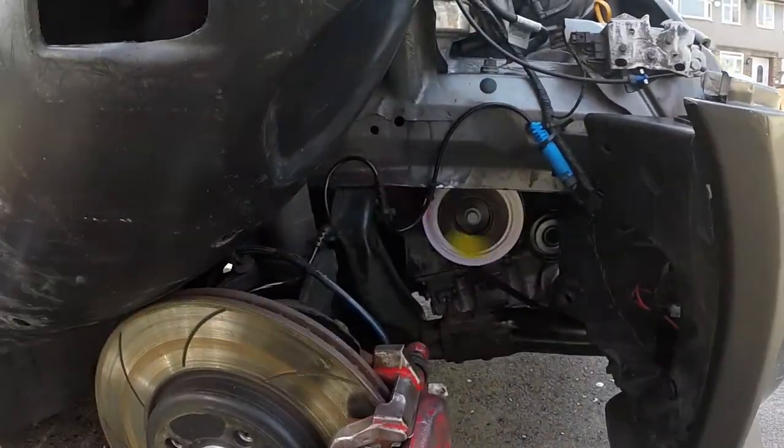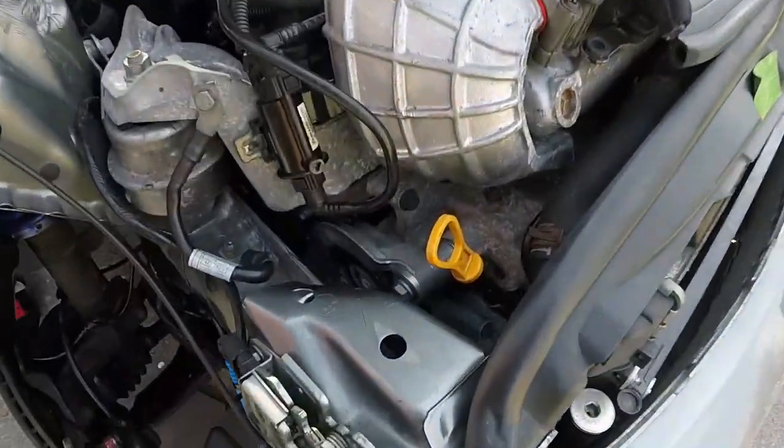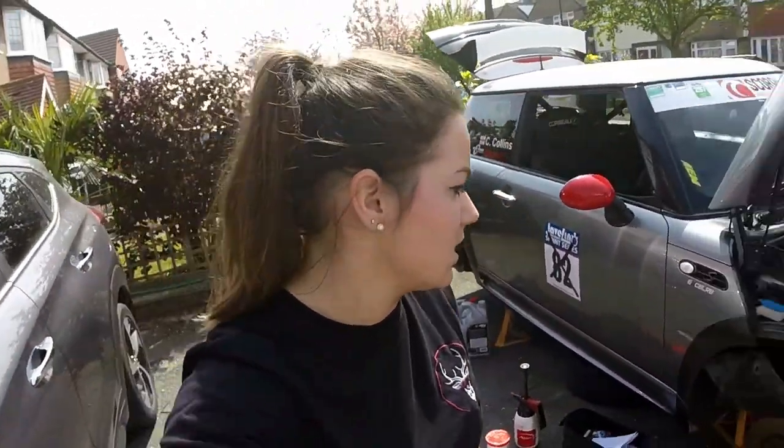So I've just started the car up to make sure it's all running correctly. I've turned the aircon on as well — so that's all in place and running as it should do. The new tensioner seems to have done its job. And when I put my foot down in third gear and gave it a quick pull, no more slipping — awesome stuff. So new tensioner and ATI dampener is fitted. I can't say I've ever done one of those before, but first time for everything — all looks okay, running sweet.